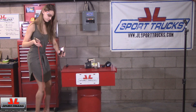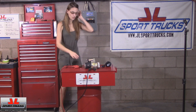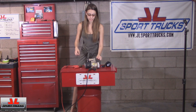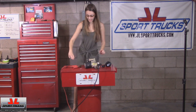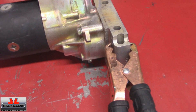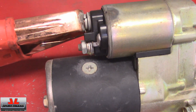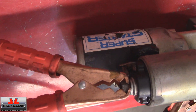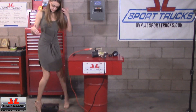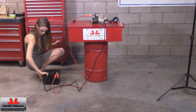I'm going to show you where I'm going to hook these up. Obviously this is going to be in your engine — it's going to be bolted. This is the metal in your engine, so the negative is just going to hook on right here. And the positive is going to hook on to this. Red, positive — there's a plus sign, it's pretty straightforward. And then black, negative — negative sign.